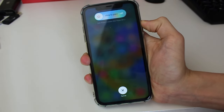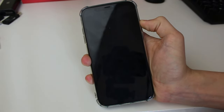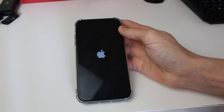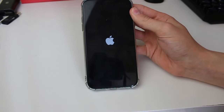Don't touch anything — just keep holding the power button. In a moment your phone is going to go black, and that's the first part of the restart. Keep holding the power button until you see the Apple logo appear, then let go as soon as you see it. If you keep holding it, it may start recovery mode, so make sure you let go quickly. Now your iPhone is going to launch.